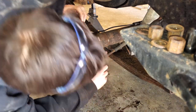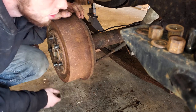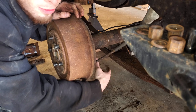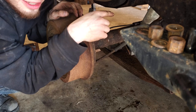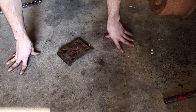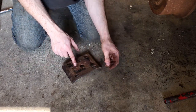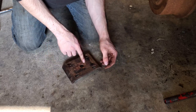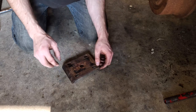You can see that the axle is at a slight angle — that's because I haven't done the other side yet. What I'm going to do is get the U-bolts in, snug them down just a little bit — not real crazy tight, just enough to hold it in place. When I do the other side I'll come back and torque everything down. Normally when I'm taking rusty parts off I like to freshen them up, take some rust off and give it a coat of paint. I'm not 100% confident the paint will dry in time because I want to get this thing moving, but we'll give it a shot.